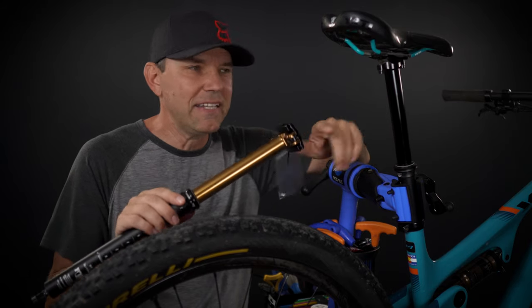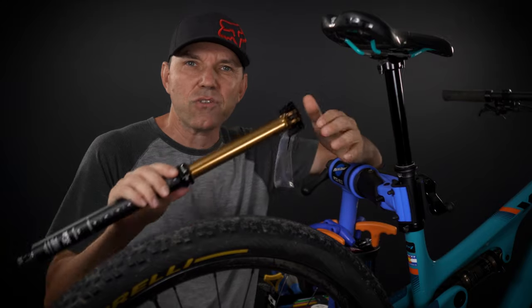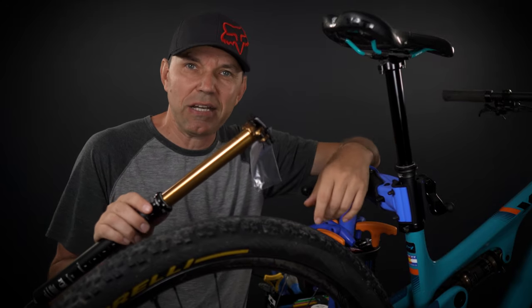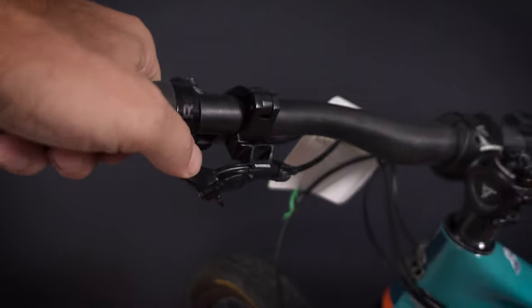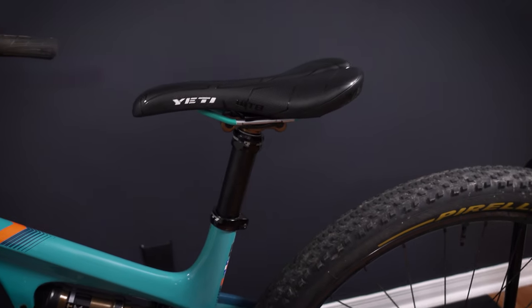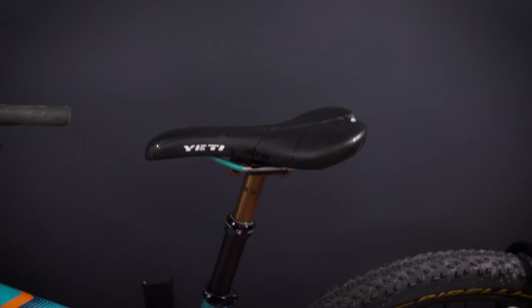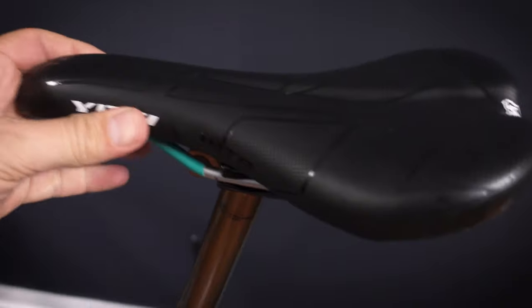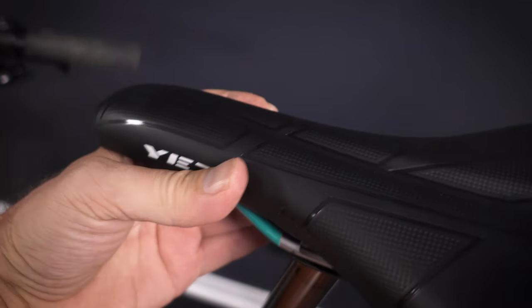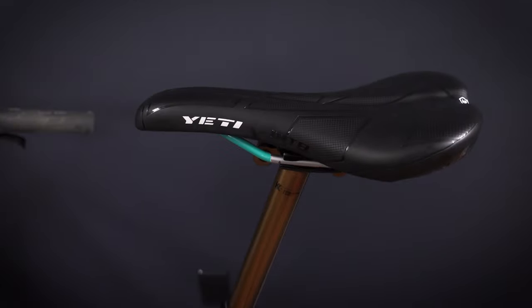The installation of the new dropper is no different than the old — you still use that little ferrule at the end of the cable, so I'll skip the details. I ended up going with the same Shimano XTR remote, which even though only has 7mm of pull, it's good enough for this new Fox Transfer just like with the old, and it provides good control on where the dropper stops. At the end of the travel you get a big bang, which might be a bit scary but I appreciate it on the trail. As for side-to-side movement, you do have a tiny bit that is not dissimilar to the old dropper or other droppers I've used in the past.